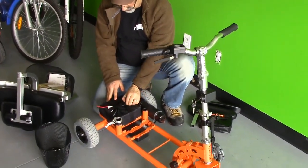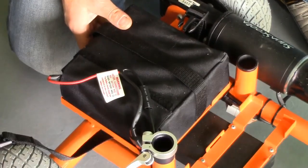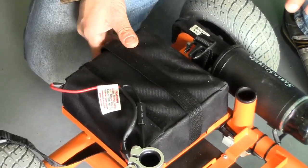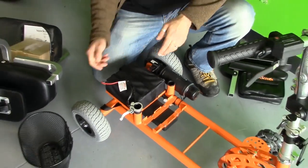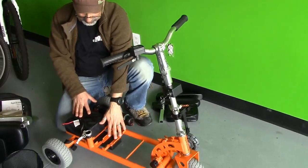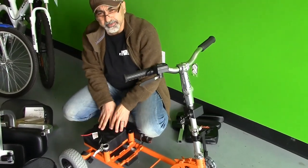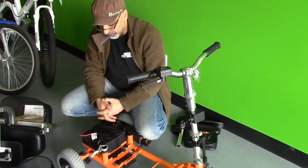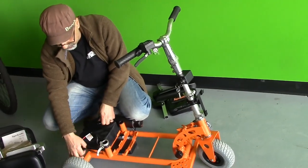This is the battery. It's very simple — a 12-volt, 20-amp battery. It gives you about 10 to 18 kilometers of autonomy at a speed of 10 kilometers per hour. The battery is rechargeable and good for at least three years if you charge it on a regular basis. You can replace this battery, and there is a place for a second battery right here. You can also put a bigger battery as needed. It comes with a charger and is very easy to use.